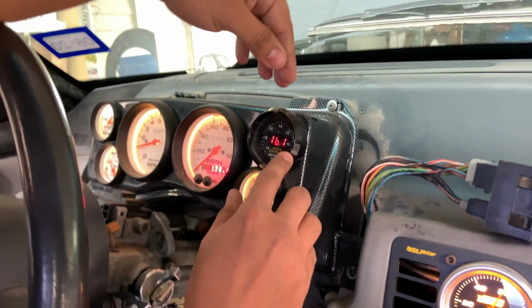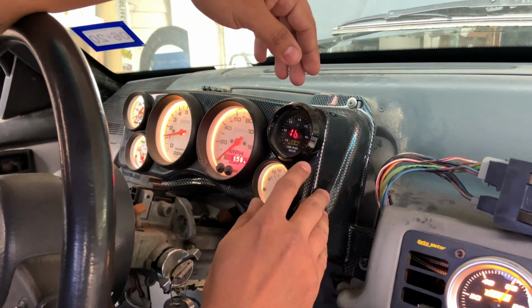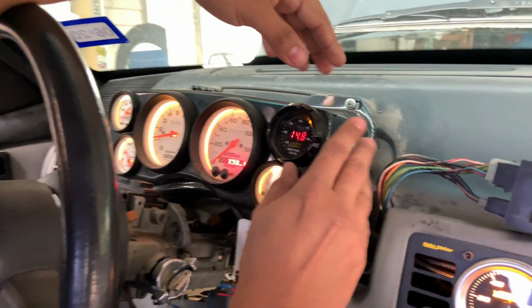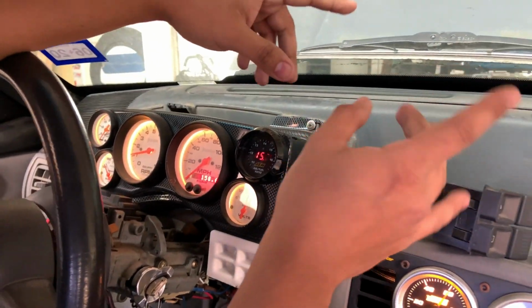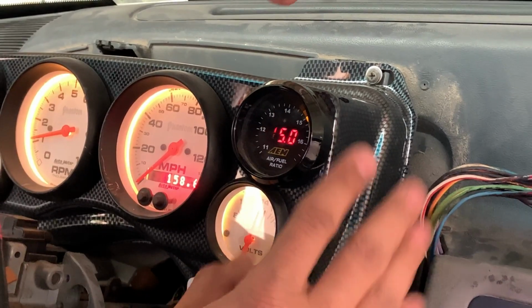So it looks at the bottom portion, it might need just a little bit more fuel, but across the board it looks all right. Yeah. But if this starts to average out more around the 14-15 range, then we'll leave it as is. It's probably just the inconsistency of a cam with the turbo and everything. Yeah. So it looks like it's stabilizing now. Yeah, it is. That's good.